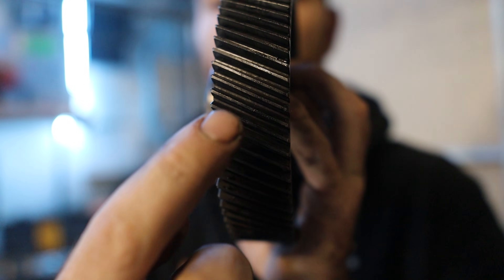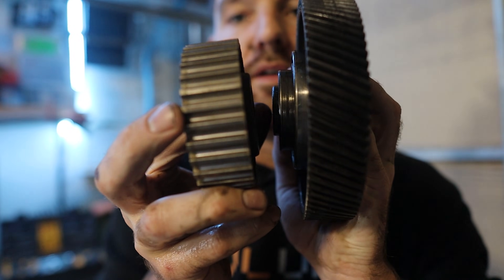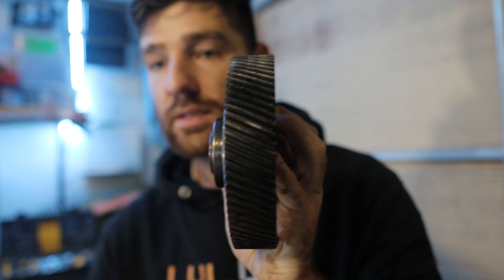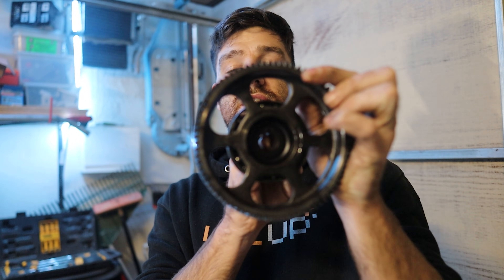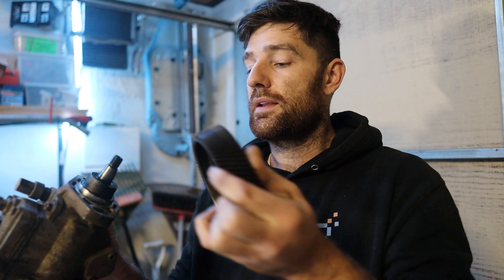You can see how these grooves are on an angle compared to the ones on this camshaft gear that are straight — that makes it a helical gear. So that makes it tricky to align the numbers with the relevant gears on the balance shaft and on the idler pulley. What I'm saying is you'll be so focused on that, that you're not paying attention to this slot that's meant to accept the woodruff key. And you can actually get these completely misaligned and still have enough room to thread the bolt on. I'll show you a close-up.